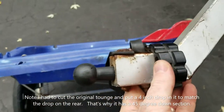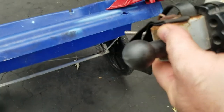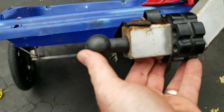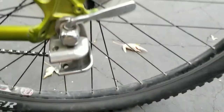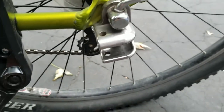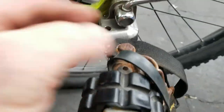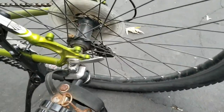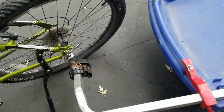On the front end, it had a really crappy clamping system that just clamped on the frame and bent it all to schmuck. But I picked up this hitch — I put a piece of oak in the end of my channel and put this nylon ball socket through there with a bolt through it. This goes into a receiver on my bike. I put that in ten years ago and all my hauling, it hasn't been damaged one bit. There's your bike skewer and there's the socket — look at that ball goes through. You slide that guy right in there, then you've got this little pin that drops right in front of it, and a little rubber strap underneath. It's a ball socket with no friction per se, and just that little bit of bouncing you get when you pedal, that nylon can take that vibration up and gives you a real dandy hitch for a bike.